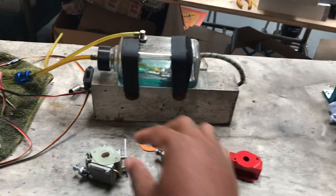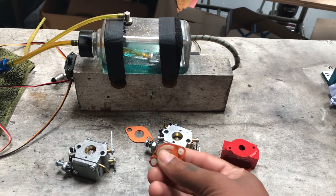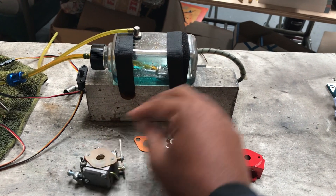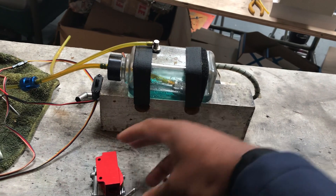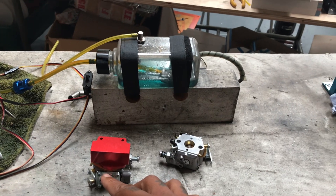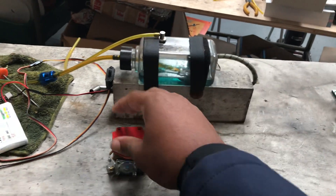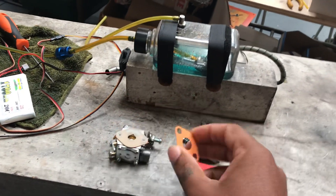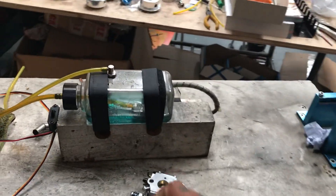Notice the holes are in the front but the heat spacer groove is in the back — that would be blocking the pulse hole of the carb. When you get the kit, I install everything before I ship it, and I take my time to do it correctly. Usually what I do is put a bit of nail varnish on the carb up to the heat spacer and up to the carb manifold, so when you take it apart and reinstall it on the engine, you can match the paint marks and know exactly which side the heat spacer goes, avoiding the problem of blocking the pulse pump.